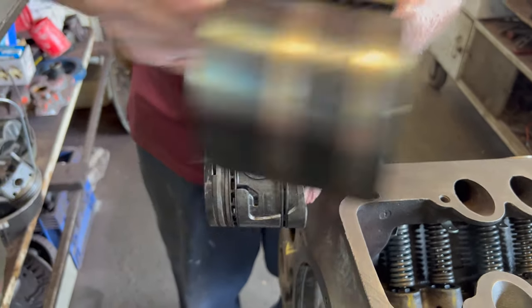This motor has one of the new gear reduction starters on it — it's a 12-volt Power Master XS. You can also run a 6-volt starter on 12 volts — it spins over faster and they'll live if you have a good starter. It also has a set of 'Reds' headers on it — made by somebody back east. They're nice headers and they sound great too. We're ready to deliver it and make the customer happy.